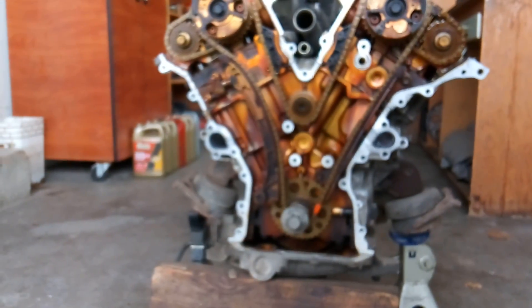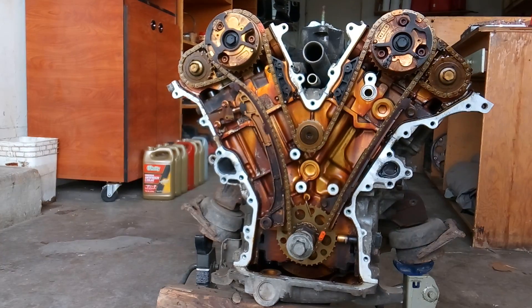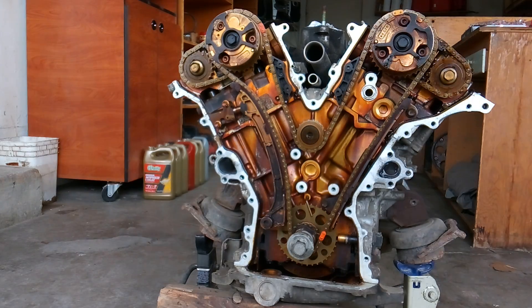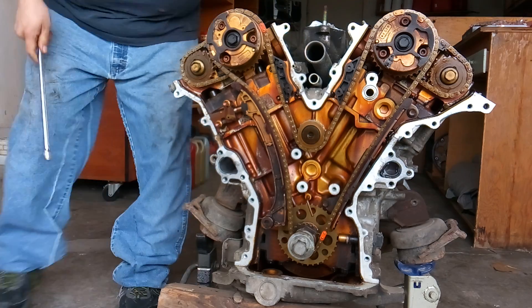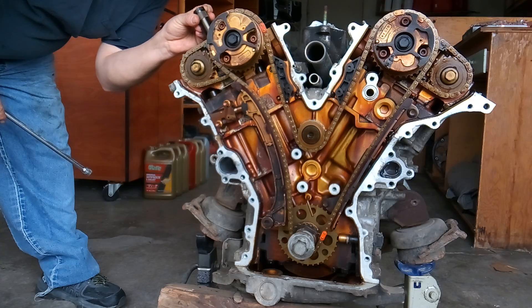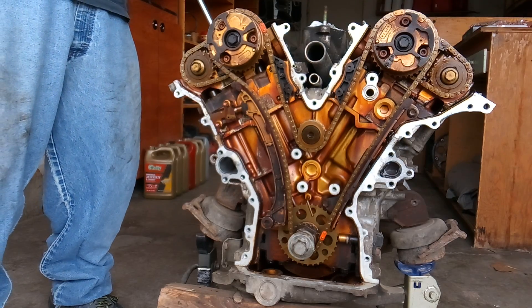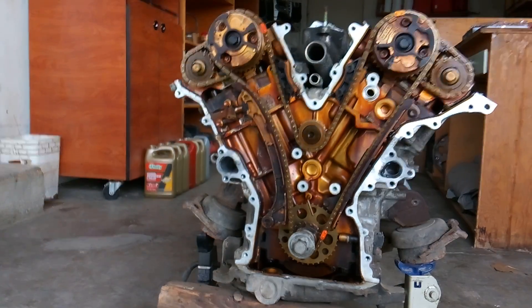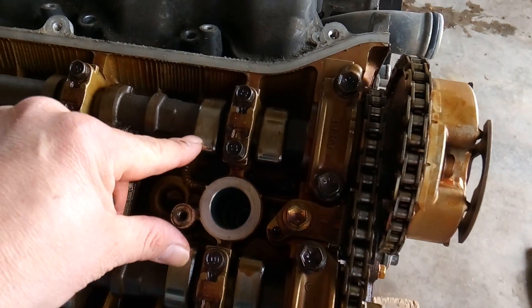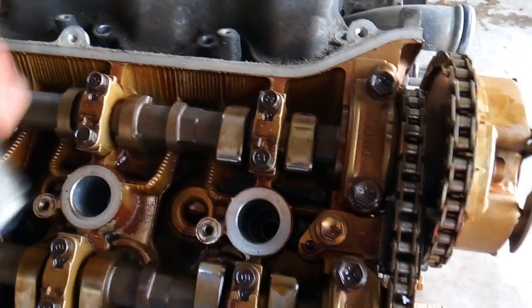If you want to feel safe about it — because if you mess this up and install your chain wrong you'll damage your engine and it costs thousands of dollars — go ahead and use a flashlight and look down to verify that piston is all the way up. You can take something very gently and confirm — that's the top of that piston, so I know the piston is all the way up. The final verification that we're at TDC is checking your valve lobes on cylinder number one. If your valve lobes are pointed up, that means all the valves are closed and that piston is all the way up on the compression stroke.